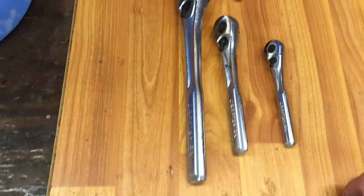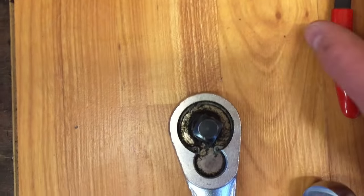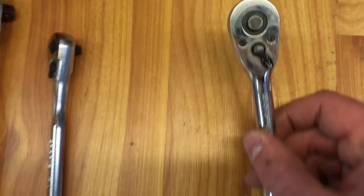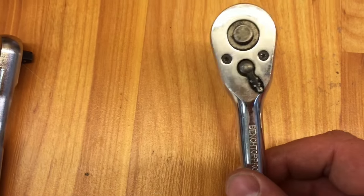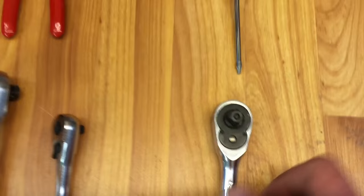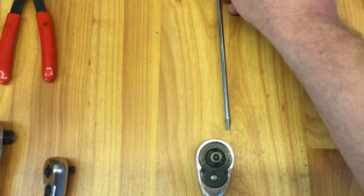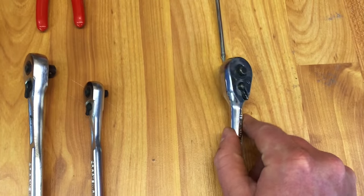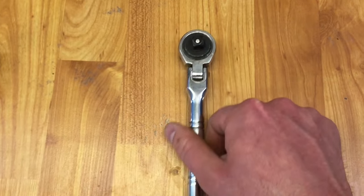With the first style, it's taking a lot of force. To get them off you'll need ring pliers, which are these right here. If you have this style here, you'll need a six-point screwdriver or ratchet to remove those bolts. I have one here but it's just one size too big, so unfortunately I can't do this one for you guys, but it's going to work exactly the same as this one once those screws are off.